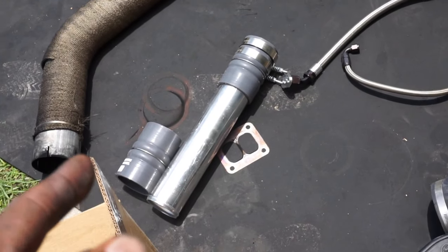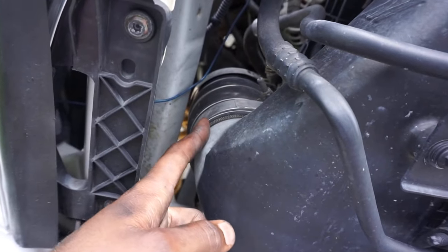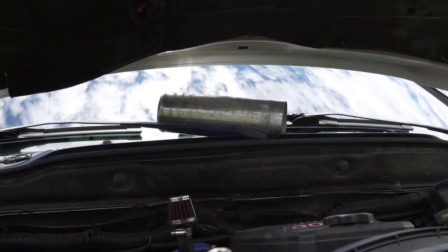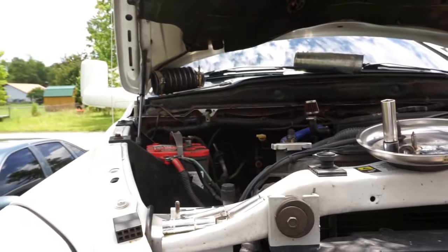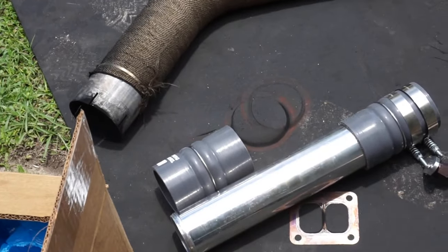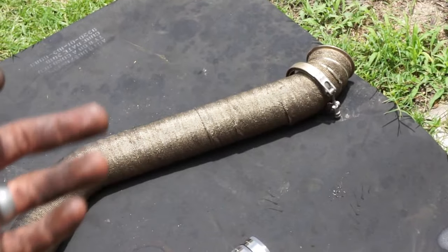Fun fact: when I ran my S467 setup I never used the original three-inch hot side pipe or boots because I have a Mishimoto intercooler which has three-and-a-half-inch outlets — those were too skinny for it. So that right there is the actual Mishimoto boot along with the boost pipe — that's a three-and-a-half-inch boot pipe and a three-and-a-half-inch boot. I had to do a little fabricating, pretty much cut it in half because it was originally set up for the stock HE351 turbo setup.